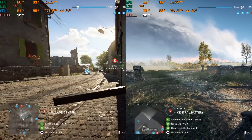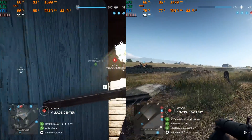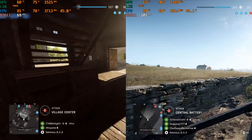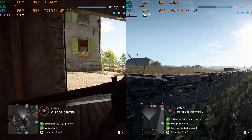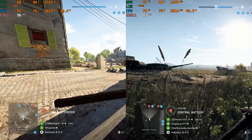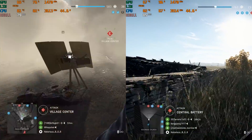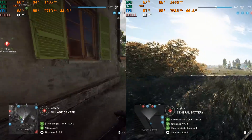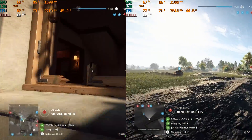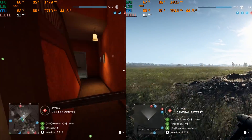All right folks. On one side of the screen we have Lenovo's blue Smurf goo, and on the other side we have the Thermo Grizzly Cryonaut. Thermally, can you tell the difference? The GPU is running in the high 60s — nice job there, Lenovo. And the CPU, once the wattage settles at around 45 watts, does run at around 80 degrees. This is uncapped. Thermal performance is outstanding on this chassis, and a repaste yielded no results worthy of your time.